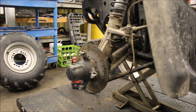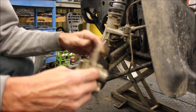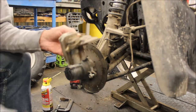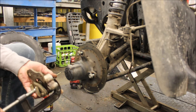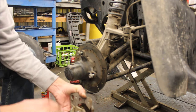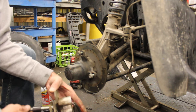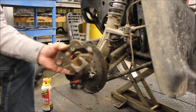I'm going to take a C-clamp and squish it. Because it's been sitting for a while, I could even grab an air gun and blow this off. Grab a little PB Blaster and spray that — it's lubed up. I'm going to squish the cylinder in. If I have to put a lot of pressure on this, then I know it's seized up. There wasn't much fluid in there even though I back bled it, so that's making me wonder if there's no fluid running through that line.